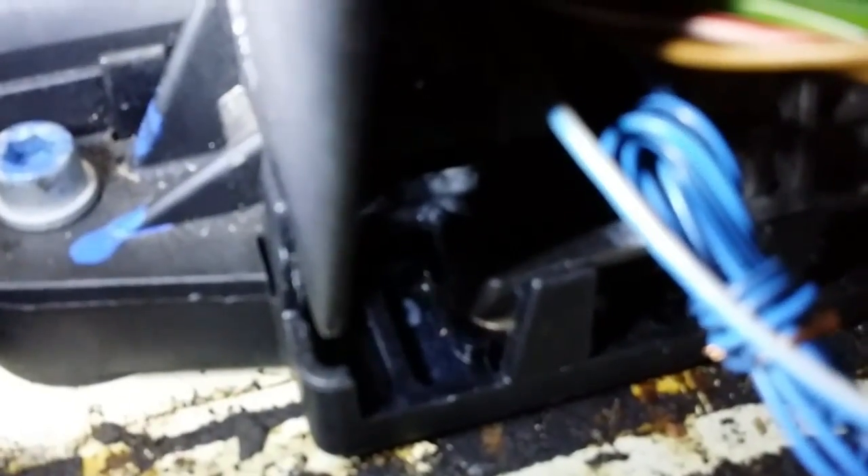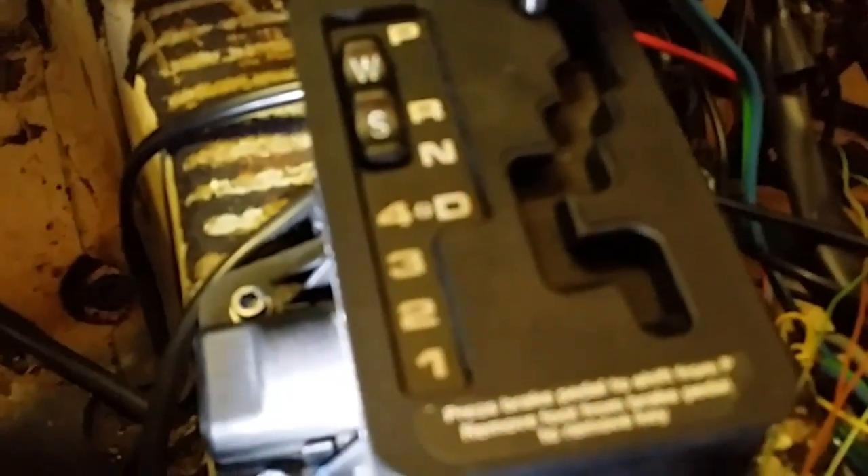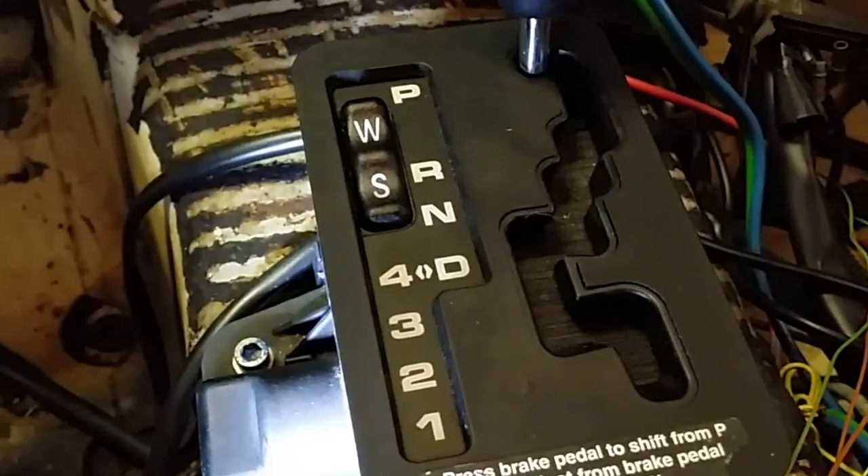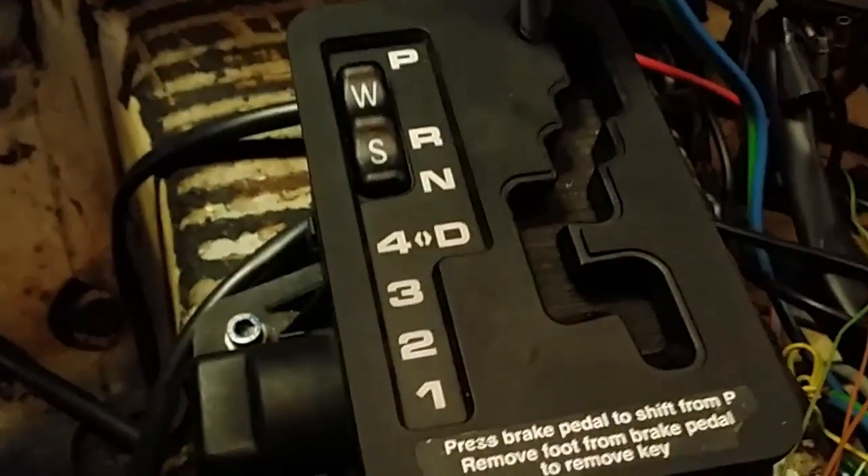Additionally, I found I had to shim this plate down here — it's kind of hard to see, but there's an indent plate. I shimmed it up and you can probably see a metal washer down there. To get the indents in the right place corresponding to the gate on the shifter and send the right reading — the shifter is now in pretty good shape.